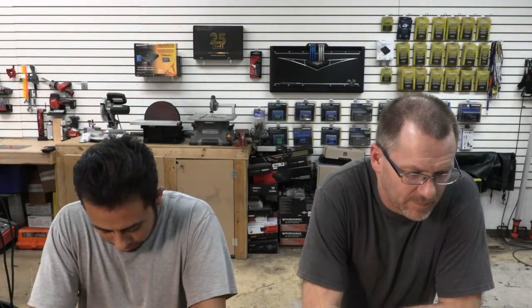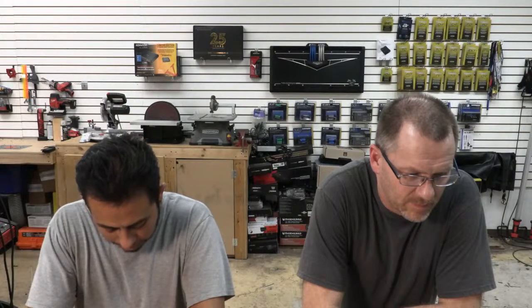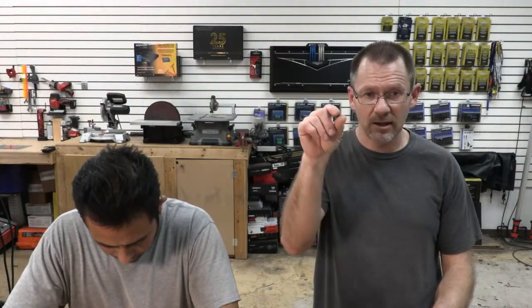My car has factory components in the lower front door and dash. If I replace the speakers, do I need the new crossovers that come in the box? It's a 2017 Audi A4 non-B&O system. Yes, you do. You're going to need the passive crossovers that come in the box. First thing you've got to do is get the factory speakers out. A lot of the time you'll look at the tweeter and there'll be a cap on it. If there's a cap on the factory tweeter, there's no crossover in the system, meaning you're going to need to use your aftermarket crossover. And in some of those systems, the mid bass is on its own channel, and in some, they're all on one set of channels, meaning the 6.5 and the whole three-way set is all passive out of the factory radio. Then you've got to put the crossover back in.